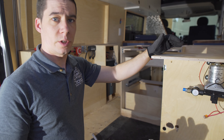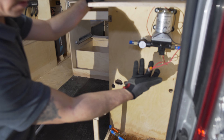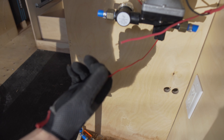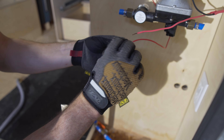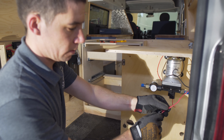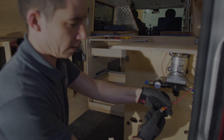What some manufacturers are switching to are called lever nuts. Here's a lever nut we've installed — I have to put a lot of force on that to actually get it to slide off. On stranded wire it really doesn't want to come off, and they're nice and serviceable and don't damage the wires. That is another option other than using butt connectors on everything.